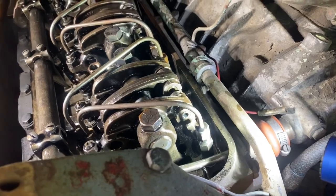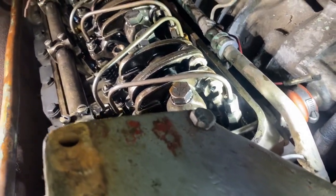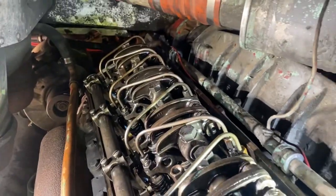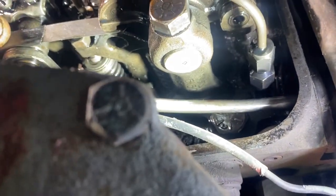But the 0.017 has fit freely. I'm not even touching in a bunch of them. But we're getting it all dialed in. And then we're doing the exhaust here on this side. We've already completed it on the other side. So it's loose right now. I've loosened the nut. If I take this 0.017 feeler gauge between the bridge and the rocker, I want to just have a nice smooth pull on that when I do it.